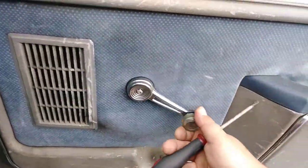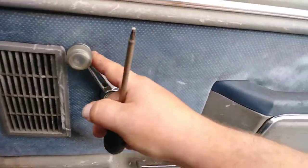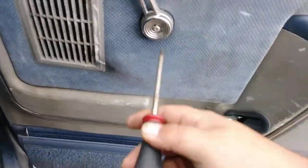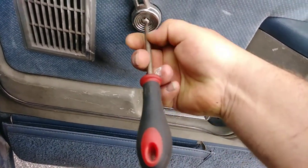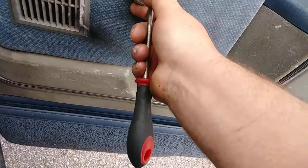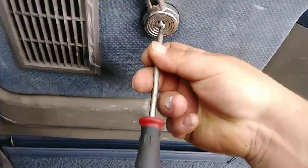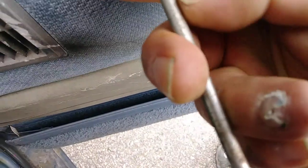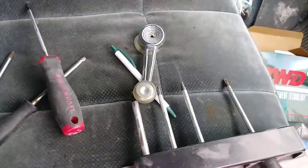Let's go to this side. What I like to do with a roll-up door is put the window all the way open so it can't move anymore — you got to turn it to the left so you have nothing working against you. Just unscrew that. Make sure when you first start unscrewing it you put plenty of pressure, because these things have not been off since 1986.